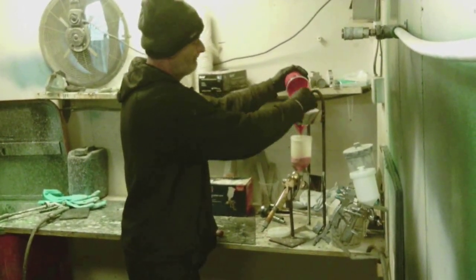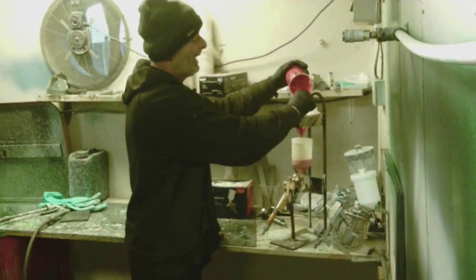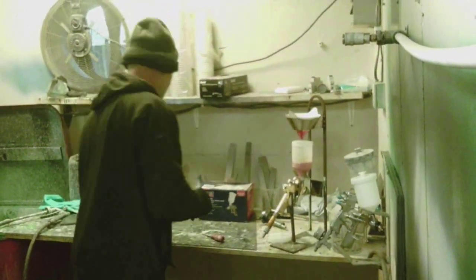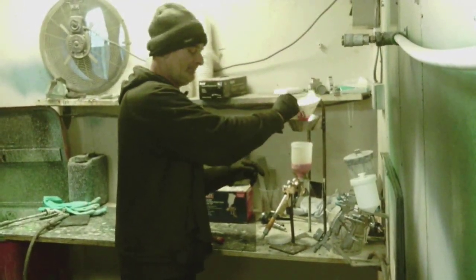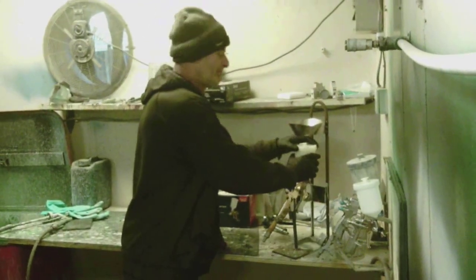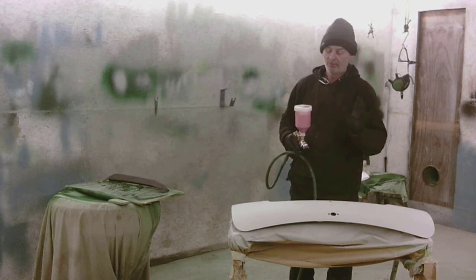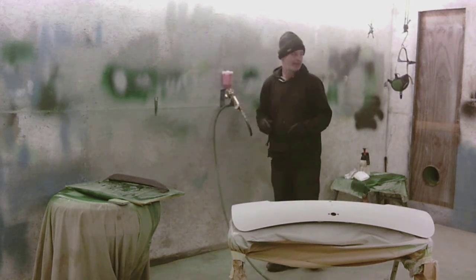Always use a strainer and you won't get any bits in it, because often it's not actually the paint that gives you problems — it's if you've used an old tin of hardener, sometimes you get some bits in it and it sets off. I don't like using the strainers in the gun itself, but some people do. Let's go around the spray booth and lay a bit of paint. We've pre-cleaned the panel with wipe, the gun is ready, I'm going to put my mask on and we're going to give it a coat of paint and see how it comes out.